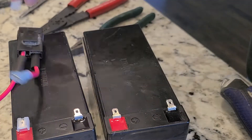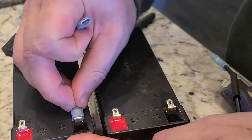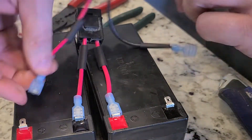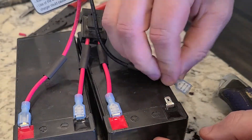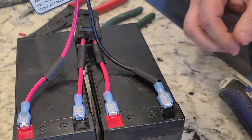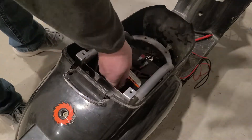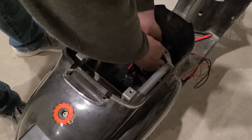Then we take our newly crimped wires and put them onto the new batteries. Make sure you get the order right — we're working these in series. The fuse goes between the innermost black and red. The outer posts: the wire on mine was color coded with a red wire and a black wire, so you can just hook the red to the red and the black to the black. The assumption was that the battery was the problem with the scooter, but before putting it back together permanently, I wanted to double-check that, so I'm putting the batteries in temporarily and reconnecting that connector.